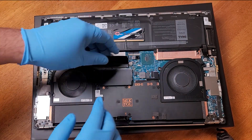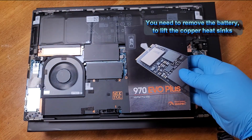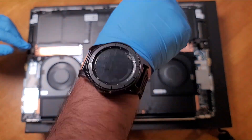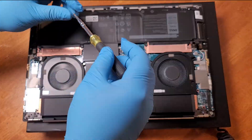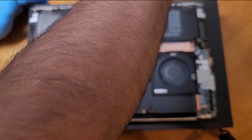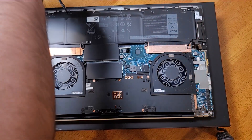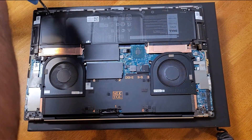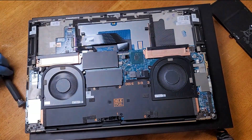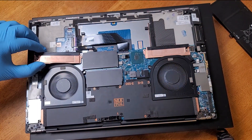We're also going to replace the hard drive. It comes with a one terabyte M.2 PCIe NVMe SSD with Windows 11 Home loaded. Windows 11 is not my favorite, so we're going to replace it with a Samsung 970 EVO NVMe M.2 one terabyte — link in the description. We're going to equalize the storage: one terabyte for the operating system, games, and editing programs. This unit also has a second NVMe slot where we're going to put in a Samsung 970 EVO NVMe M.2 SSD with two terabytes of storage — link in the description.